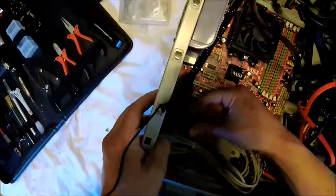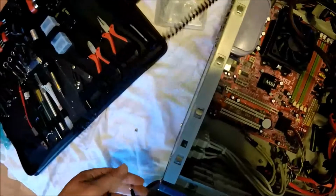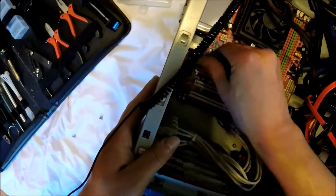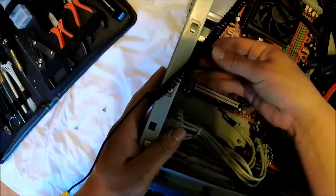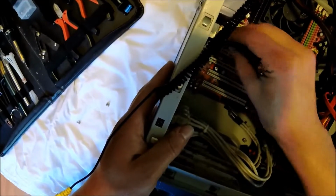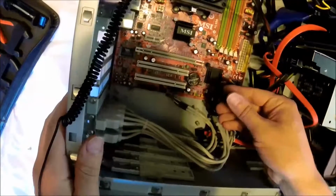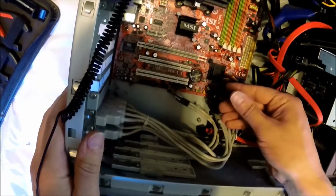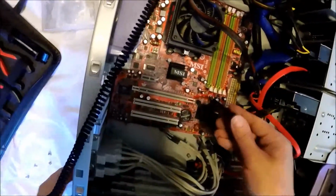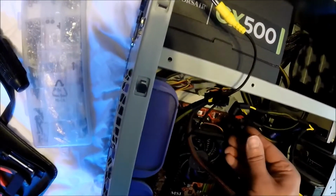In the toolkit I'm using a micro claw tool with a plunger at the end. It makes for easy removal of screws that are in between capacitors and things like that on the board. As long as the screws are released from the stays below, you can pull the board up with the screws on it, but sometimes they get lost in the bottom of the case if there's an additional tray. So I try to pull all the screws off beforehand before I remove it from the board.